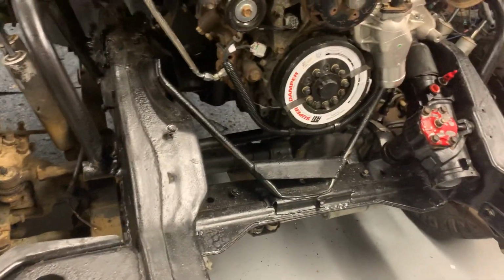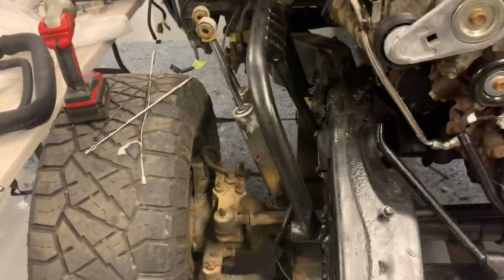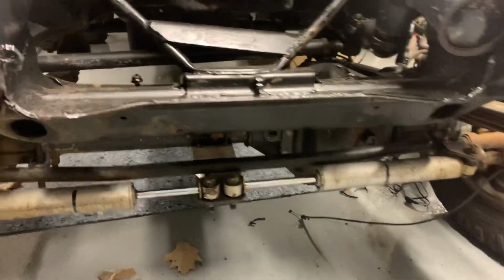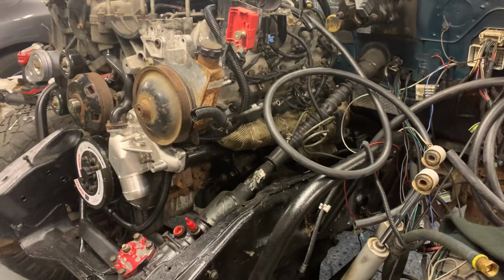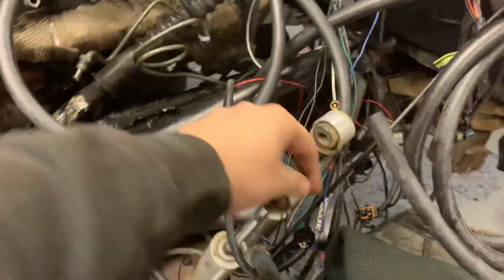So it's an 86 axle, re-geared to 3.73, Yukon ring and pinion in the front. Like I said, crossover steering. And then it's just got like a BDS dual steering stabilizer kit on it in the front. The shock tubes, they're either Sky or WFO, I can't remember which, but they're just the weld-on dual shock tubes, and then I'm just running regular BDS gas shocks.